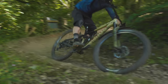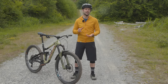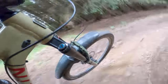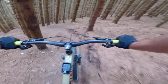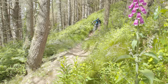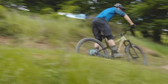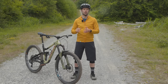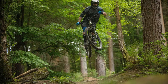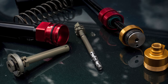Moving away from the air spring to the chassis's fairly obvious redesign, I found the forks still blended that unmistakable stiffness and flex the old Lyric was renowned for. On steep terrain, in high-load corners, where most of my weight was pressuring the front end, there was no perceptible flex or twist and the front wheel tracked the line I pointed it on with pinpoint precision. In high-speed corners, it was the same story. This accuracy didn't come at the expense of comfort, and steering deflection caused by an overly stiff fork wasn't a problem. Although RockShox has coined the Lyric an all-mountain fork, the 160mm travel version has plenty of guts to serve up enduro-like performance. As with the damper and spring, the chassis has an exceptional balance in the way it feels.